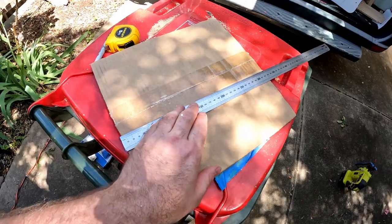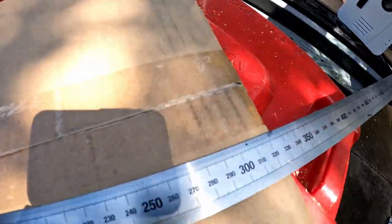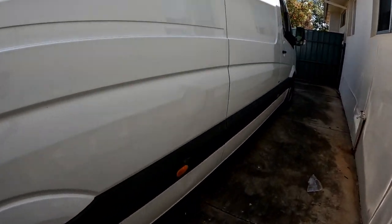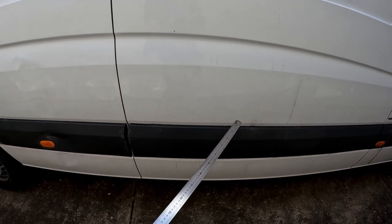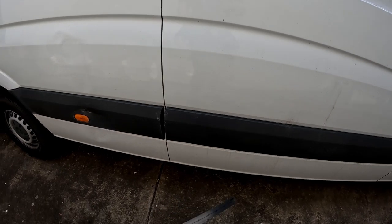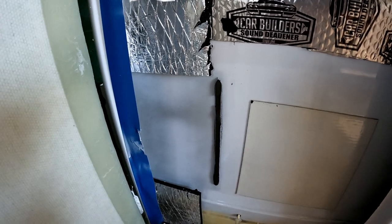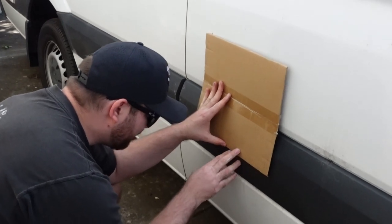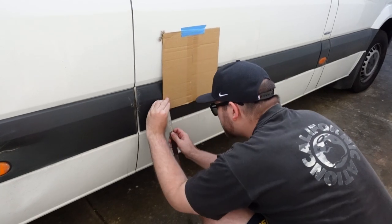I've just made myself a little template for the hot water system — it's pretty much exactly 32.3 centimetres across. Essentially if I cut that into the side of the van over here, it's going to be perfectly where it sits. I'm going to drill a pilot hole from the inside so it pokes out and that'll be my centre mark. From in here I've got a centre mark, I'll go straight through — it'll poke out the other side, the template goes on the other side so I can cut around it, and hopefully the water system slides right in. We'll make sure this is all level, measuring it against the van because that's probably the only square reference we're going to get.